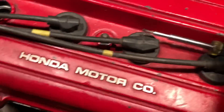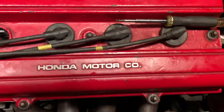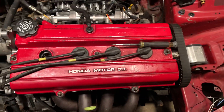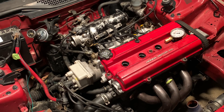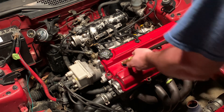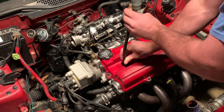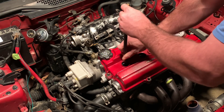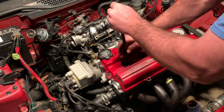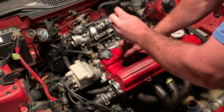I'm gonna do that on all four of them. What you're gonna want to do is take your spark plugs out. With all the injectors unplugged and all the spark plugs taken out, I'm gonna screw in the compression tester. Other than unhooking the fuel injector connectors like I've done, you can also unplug the fuel pump relay and you'll get the same effect from it.